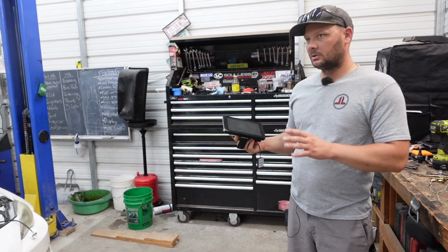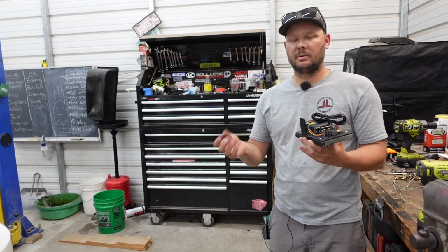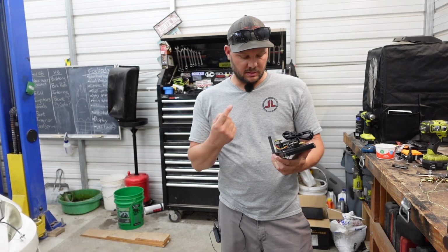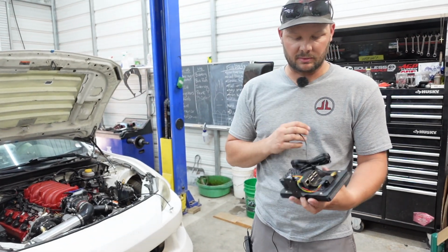So what's first? I guess installing it, I don't know, it's 4 wires. It's super easy. 2 we already did yesterday, but we got to route them. It's 2 power wires and then a CAN high and a CAN low, and you're done. Yeah, and then if you have GPS, you obviously got to route this.